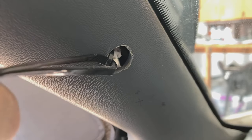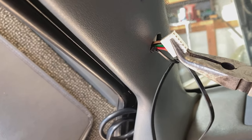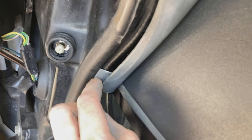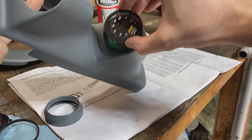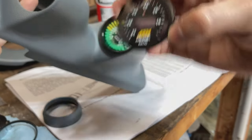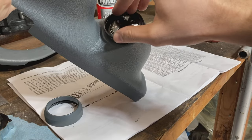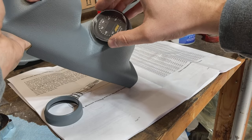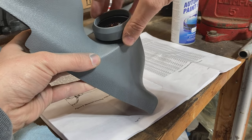It might help to use some needle nose pliers to wiggle it through. You could probably do this with the panel off the car, but I already had mine reattached. Make sure to pull plenty of extra through — you can feed this back behind this trim panel pretty easily. Just pull back this trim a little bit and start tucking it in. Go ahead and put the gauge in, make sure it's oriented the right way so that it's level, and put the backing on with the two brass nuts. Go ahead and put either the lambda side or the air fuel ratio side into the gauge, then the seal, then the glass plate, and then the screw cover. I'm going to use air fuel ratio for mine because since I'm feeding the signal in through the EGR, I think it would be easier to handle an air fuel ratio instead of lambda in HP Tuners.